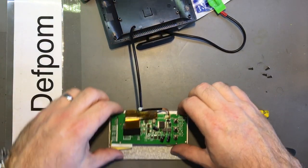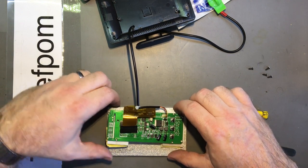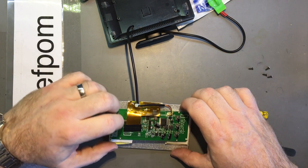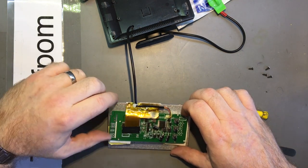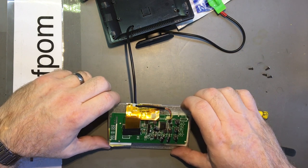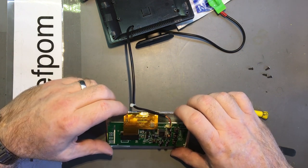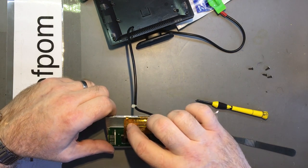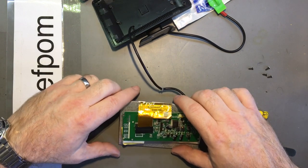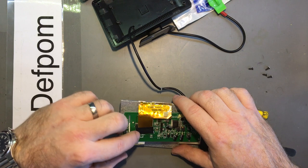So I've got to figure out what's going on with this. There's the capacitors in there. The backlight is flicking on and off, so I don't know if it's a bad issue with the power supply or if it's a capacitor which is shorting, or if the supply itself is failing. There's two cables up here - those will be the backlighting. I can see an A and a K on there.